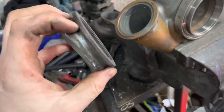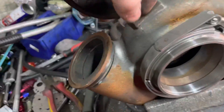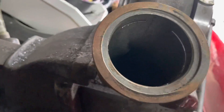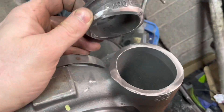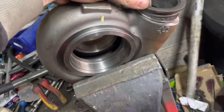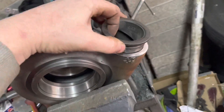So I'll cut that off — cutting this one off just now. Can't get the angle grinder in there. Fucking hell. The cast is pretty strong, even though it's about half an inch left there. I'll just get it in the vice, give it a good smack, and that'll hopefully break off. So, that's now cut off, and I've put a wee taper on here just for when we're migging it up. I could TIG it, but I'll probably mig it, because I can't be arsed.